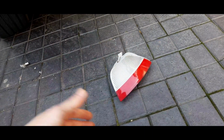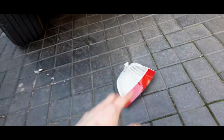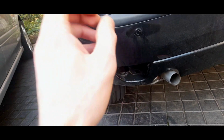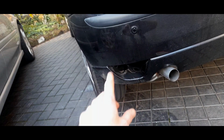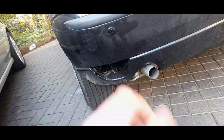as they say. It's all good for a car designer to put these cool lights at the bottom, but this sort of stuff, it's not good. This is something I would recommend you clean every 6 months. So you do this procedure, just take 5 minutes to clean those light fittings in there, and you shouldn't have an issue. But if you do need new light fittings, if they are so corroded and far gone, those white metal tabs in there, then you can get new ones. It's as simple as that.